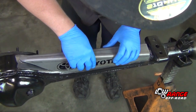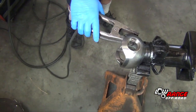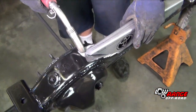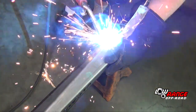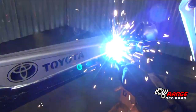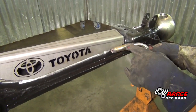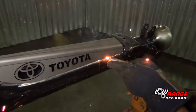Place the truss back on the axle housing. Clamp the welder ground lead to an unpainted part of the axle housing — do not clamp anywhere near the steering knuckle bearing locations. Once the truss is positioned, tack weld the truss in the three places shown. After the initial tack welding, tack weld the truss every two inches. The tip of the welder is about two inches long; notice how the technician is using the tip to estimate two-inch intervals.